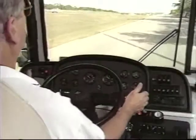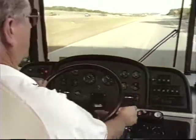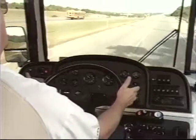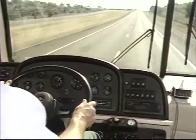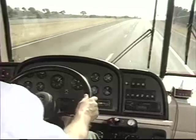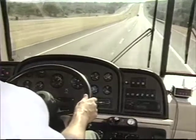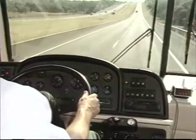There are two essential things that must be learned in order for the system to work properly. First, learn to trim out steering wheel pull — when any appreciable amount of steering wheel pull exists, you will be steering against the system. The system can only work properly for you when it is trimmed. Second, you must reprogram your personal response to what you feel. When you have been programmed to constantly make steering corrections, there is a natural tendency to continue working the steering wheel whether it needs it or not. With a little practice of letting the system hold the vehicle straight, your driving will be more relaxed and you will not be as tired from driving.